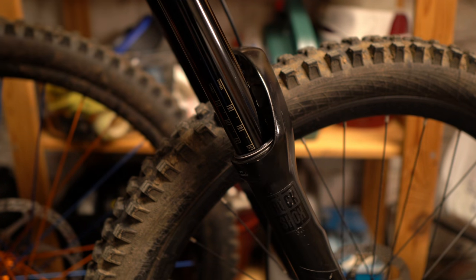That was a look at the issue of suspension forks getting sucked down into their travel. If any of the suggestions I've offered haven't resolved your issue, you might need to look into whether your damper has any issues — it may need to be rebuilt or replaced, although it generally is the air spring side. If you have any other comments or questions, please feel free to leave them in the comments below. Thanks for watching.